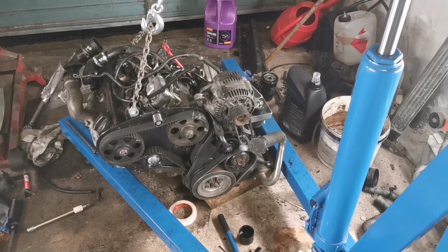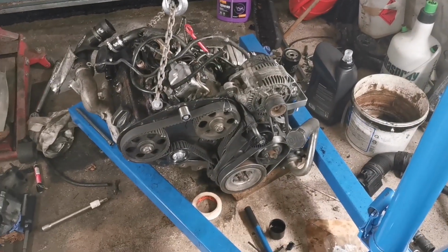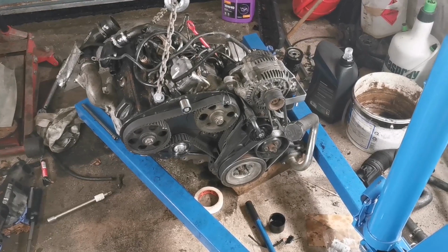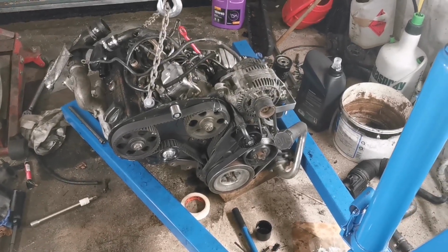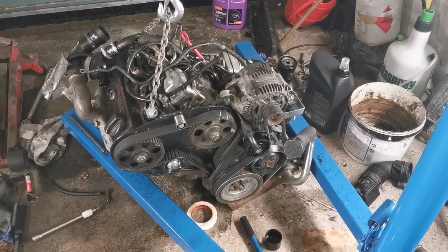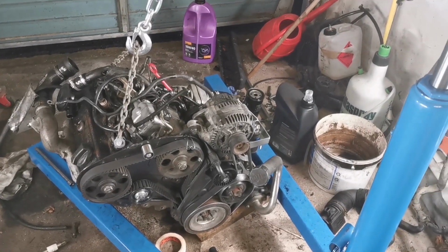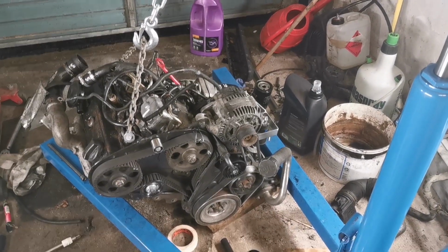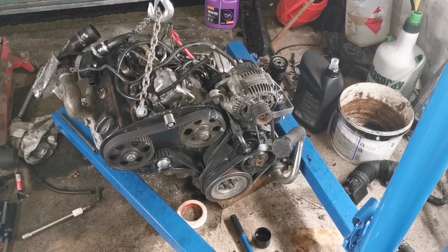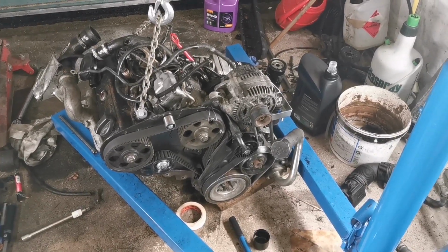Okay, so now that I know the engine's running, I've taken off the electrical harness again. Basically, my big reveal has been done, so now it's really a case of proceeding ahead to get it into the van. I am thinking that when I bolt the gearbox to the adapter plate, it's going to push back the shim plate at the back of the flywheel, and that will stop it from rubbing on the flywheel. It's only a very slight rub.